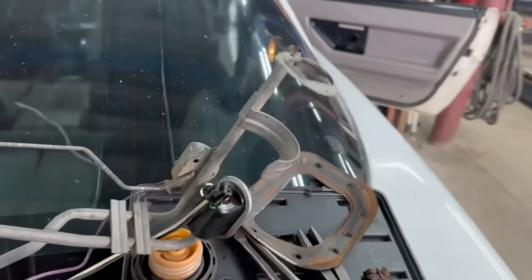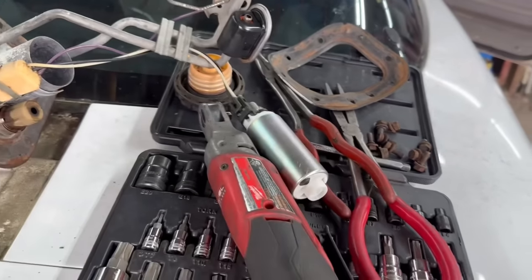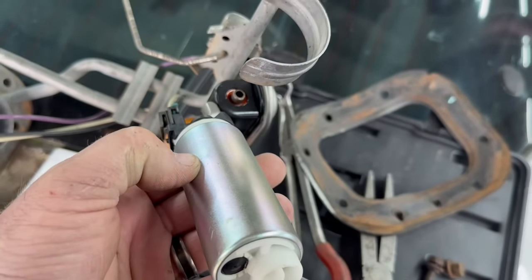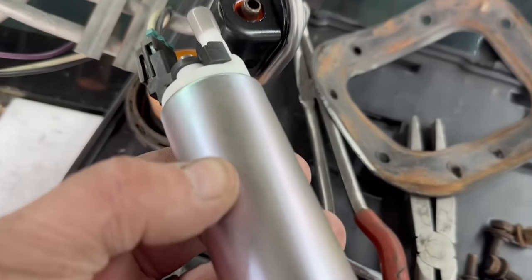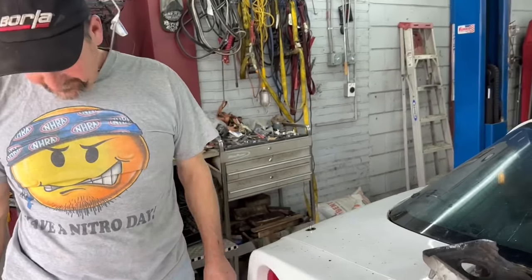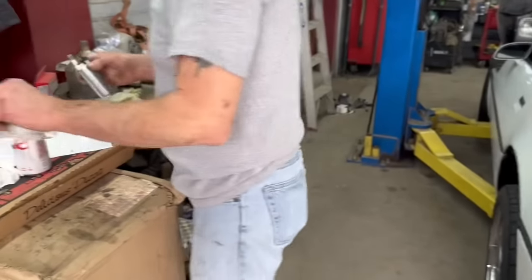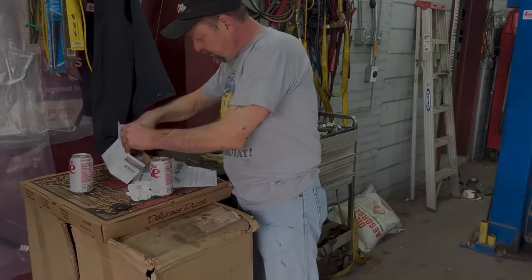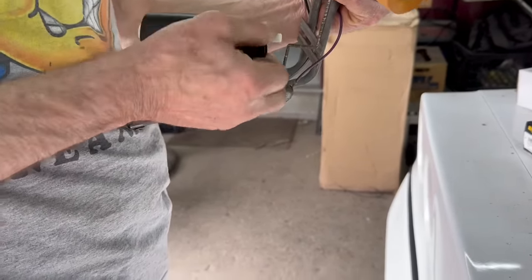He's got it out — pretty simple. We got a new pump, but the new one that came is broken — must have got dropped. That came from O'Reilly's, so he's going to get another one. Meanwhile, watch and listen: when he turns on the key it runs for two seconds then turns off — one prime. If he turns the key back on immediately it doesn't do anything, but if he tries to crank it, it immediately comes on. What are the odds of the fuel pump going out at the same time? That's just a Corvette.